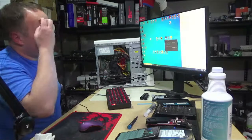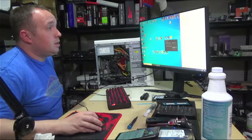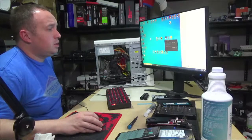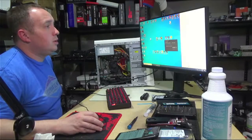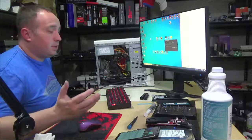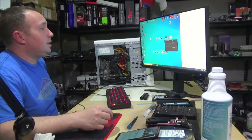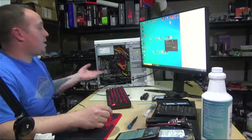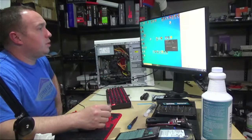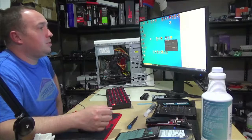So we might need the paste to settle in some too. Might need to heat cycle it some. Oh yeah, it's back down now. What are we at? No, we're at 49 on the package. Where did I just see that? Oh, that's the motherboard. Yeah, 43 to 49 on the package. But it does load up some stuff when you're installing and downloading. That can actually put a surprising amount of stress on the CPU, or just utilization, right? Which can definitely build up some heat.